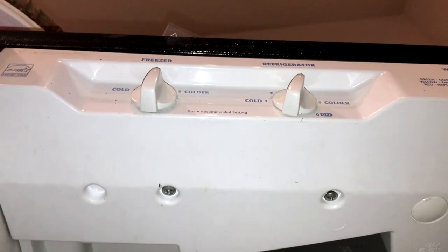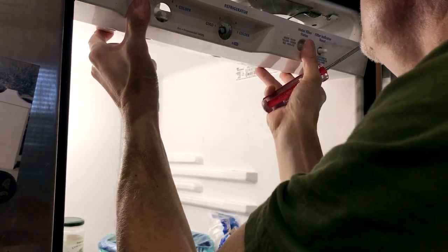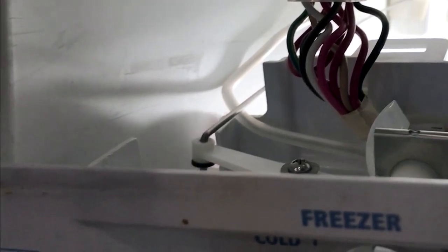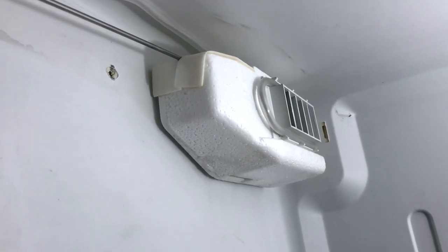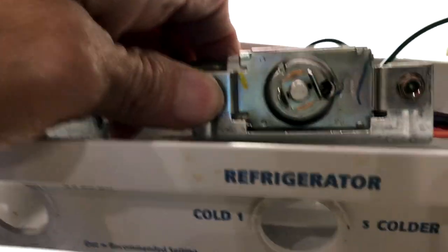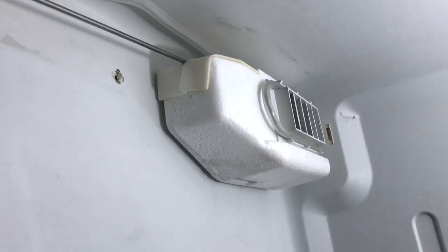You'll be able to pull it up and then unscrew the thermostat from the structure that holds it. In this design there is a metal rod that looks like it's used to actuate the baffle that controls the difference between the freezer temperature and the refrigerator temperature. I can't remove that, but I don't think I need to because I can just lift this and pull. I can lift it enough to get to those quarter-inch screws, unscrew those, and then take the tube that's used for the thermostat itself and unravel it from around there. Pull this out and then put on the new thermostat.